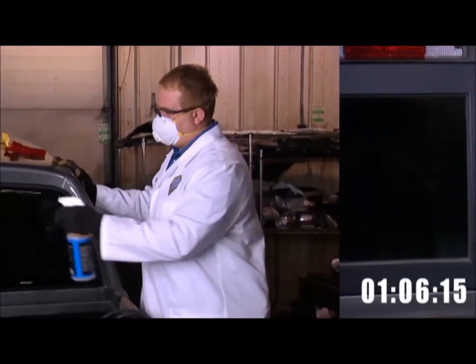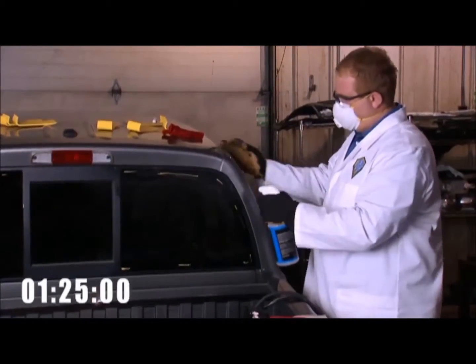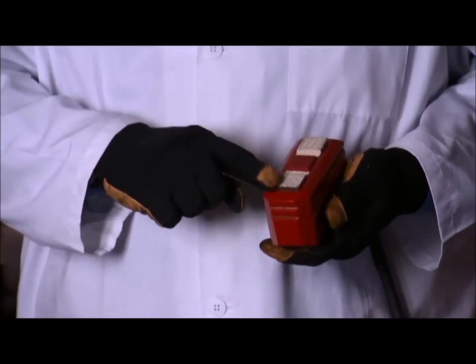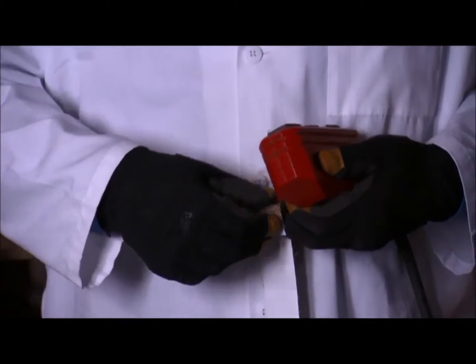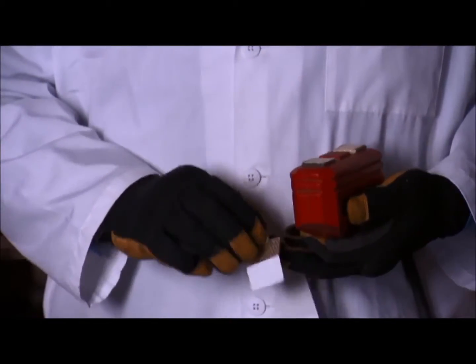Do this to all four sides. As an insurance against overheating for beginners, we can spray a thermal gel around the glass or use a damp rag to keep the metal cool. The attachment is manufactured with a non-metallic tape to protect the glass from scratches. If your tape is damaged, you can replace it with any non-metallic tape or a replacement thermal tape we offer.